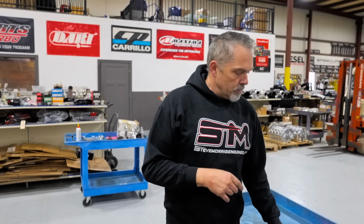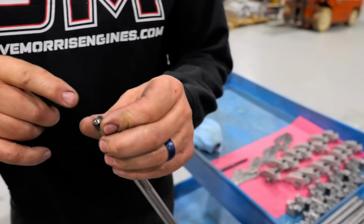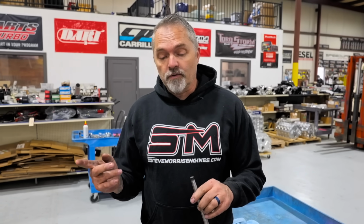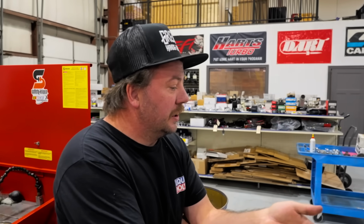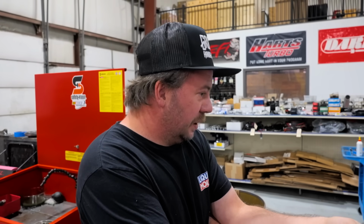And so far, if I had to guess, because of the way this is all worn in and shined back up, it looks like it happened early on, probably when you had the oil pressure problem. You said you changed oil and changed speed of the pump or something. Yeah, I turned the pump up. Yeah, turn the pump up and change the oil to a different oil, and all of a sudden it is shiny. It pretty much repolished itself and probably stayed there for the last 3.5 years. And the reason we swapped oils is because I kept seeing metal in the oil, but it wasn't bearing. It was hard metal.